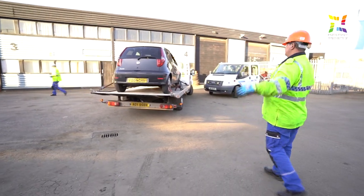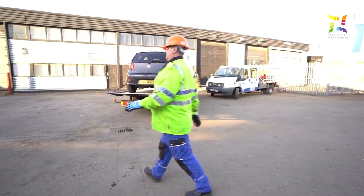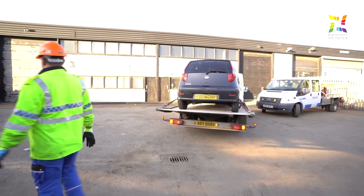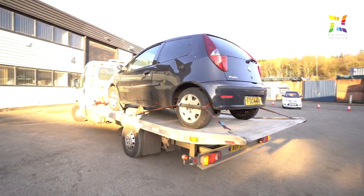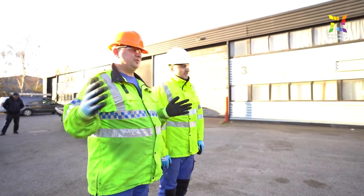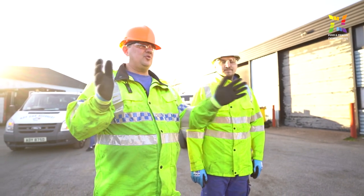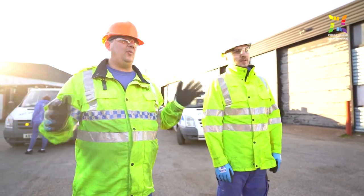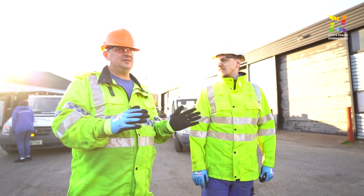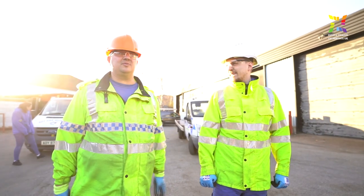This is going to go out now, so it's going to go safely here. It's not important how quick you do this job, it's important how safe you do it. You can see many videos where people put the car back on its wheels and it goes into the ditch, and we have to control this vehicle. So always think ahead what will happen if we do this. So this is the safest. I find it the safest way.